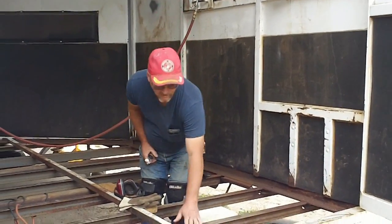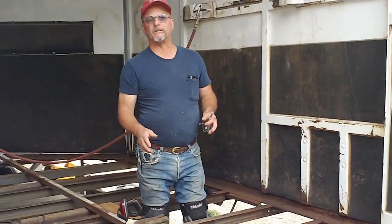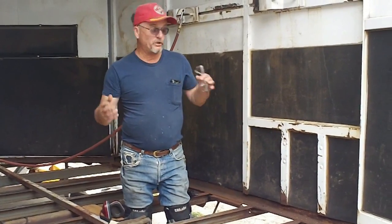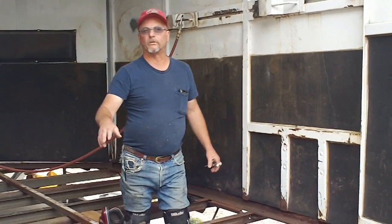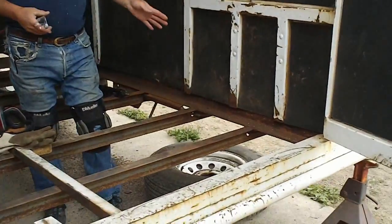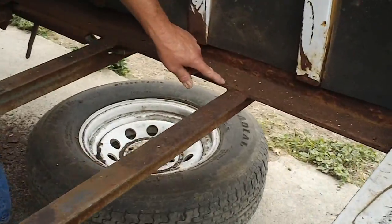The important parts are where your wood comes in direct contact with the steel, because that's where you get the most moisture, road salts, those type of things. Urine from the top is extremely acidic, which you will see on the butt wall of most trailers and the rear threshold, because that's just what they do. So I can show you up close what this heavy scale rust looks like.